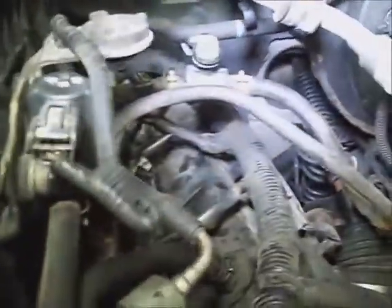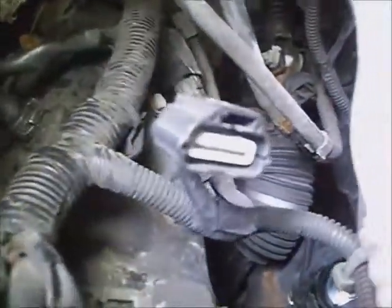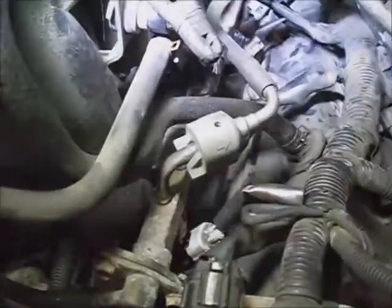Alright, check for any problems. Any injectors not fully seated, plugged in. Any plug-ins off. The only one that should be unplugged is the mass airflow sensor for the air cleaner. Fuel line's connected. Throttle body's connected. Nothing leaking antifreeze or broken. I stuck the air filter back down in it. Lay the air cleaner in and put the hoses back on the valve cover nipples, rocker cover, whatever you want to label them.